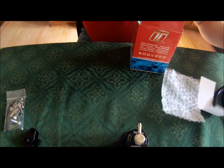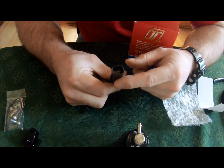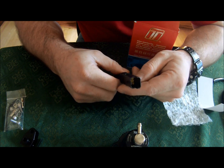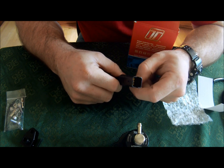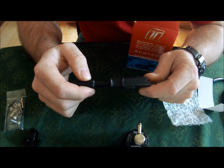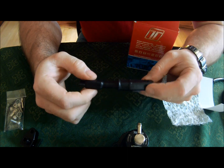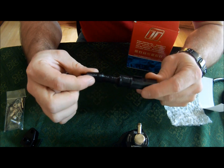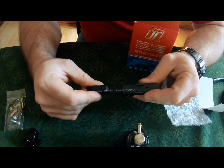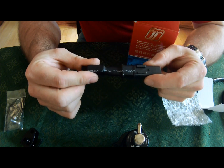And we have this — this is actually a very important part because this is going to connect to the car where the computer tells the stock diverter valve to open. Right now I have installed the Forge blow-off valve vent to atmosphere. One thing I don't like about that is that it is completely controlled by the computer still — it does have vacuum lines, but it is not vacuum actuated. I assume that this part is going to be very important if you want to start tuning or get a different aftermarket setup for your blow-off or recirc. If TurboSmart sold this separately, that would be awesome.